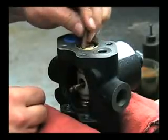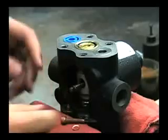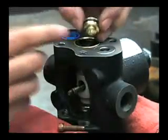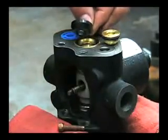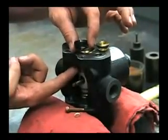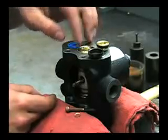Under the center bolt is a small seal washer — you want to replace that. Remove the cup spreader by gently prying it out with a screwdriver, being careful not to damage it. There's an O-ring seal inside of that. And this is your cup. If this cup is worn or melted or has deep vertical grooves in it, that would cause a leak in this area. Also, if you've got vertical scratches or pitting inside of this sleeve, that would also cause a leak.